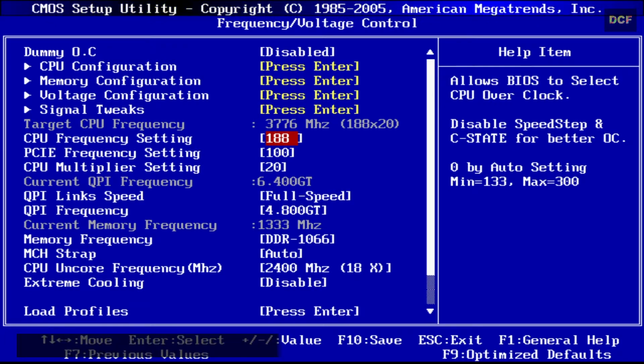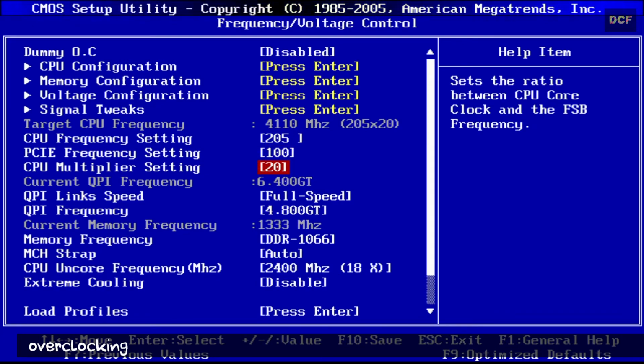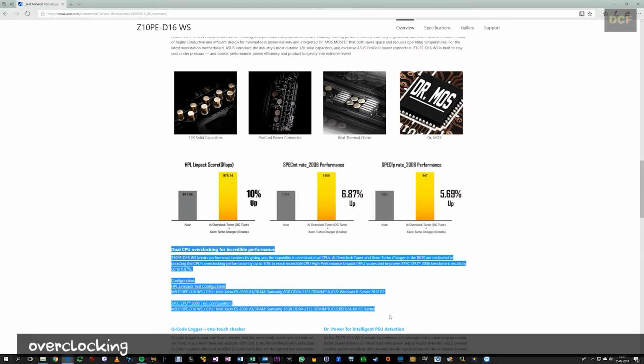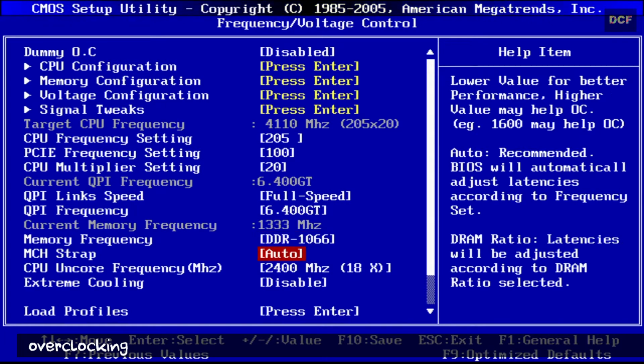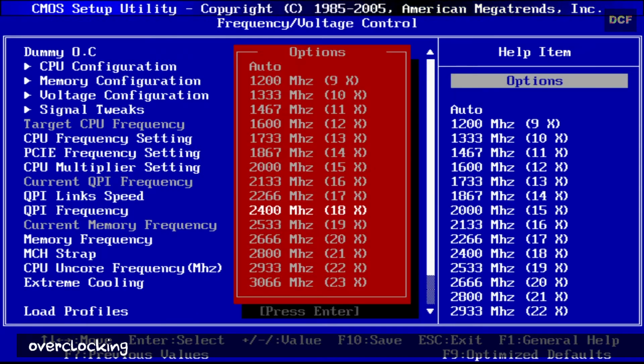Enough with the boring stuff. Next stop, overclocking. Yes, overclocking with Xeons and a dual socket board. And I don't mean some unmotivated 5% overclocking of the base clock. It has a lot of possibilities to overclock both CPUs and the RAM, but nevertheless it is hard to overclock it. First, you need 2 CPUs which are good to overclock, and second, you have the connection between the 2 CPUs which can cause trouble.